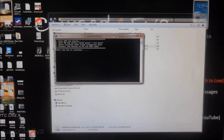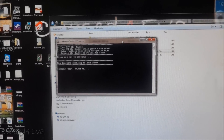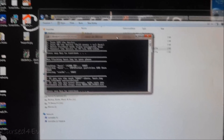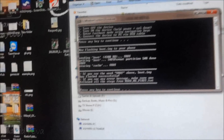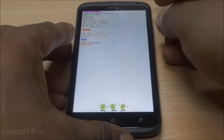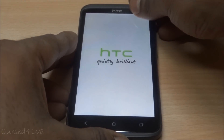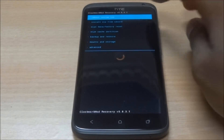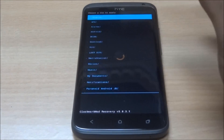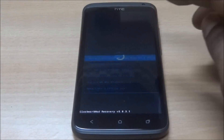It says to turn off the device, turn on the device, enter fast boot mode, and hit any key to continue — hit the key now. Once that's done, hit the power button again and scroll down using the volume keys to recovery, then hit the power button again. In ClockworkMod, select install zip from SD card, choose zip from SD card, scroll down, and first select the super vibe script and hit yes.